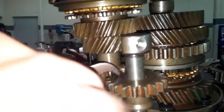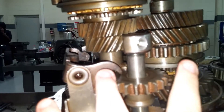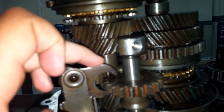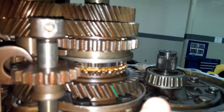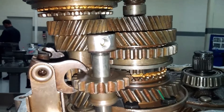For reverse, what they did was they put our reverse idler gear right here, and it will lock this gear right here and this gear right here. This one will lock to this one, and this one will lock to this one, but those two aren't touching. So where this one is spinning counterclockwise, this one will go clockwise, and then this one will be going counterclockwise — which will actually make this go the opposite, clockwise — so it'll be the complete opposite of our input shaft.